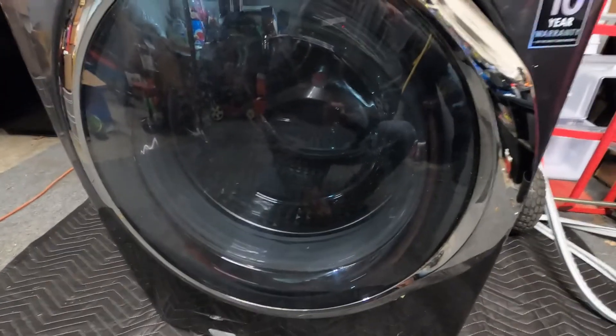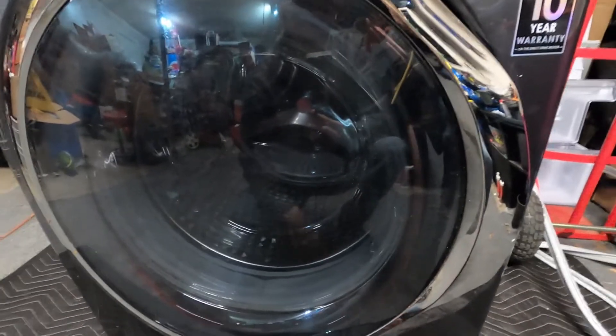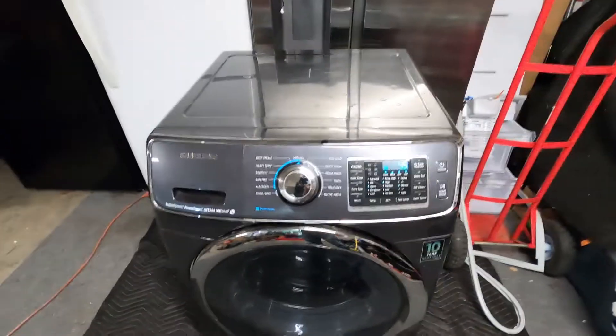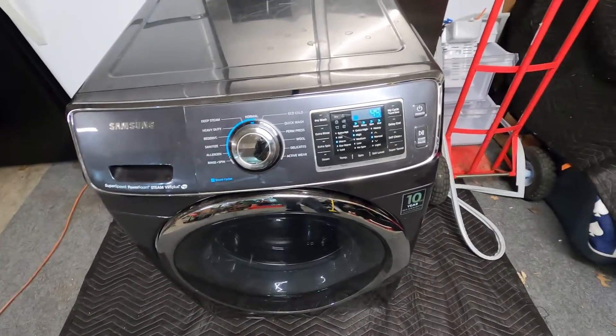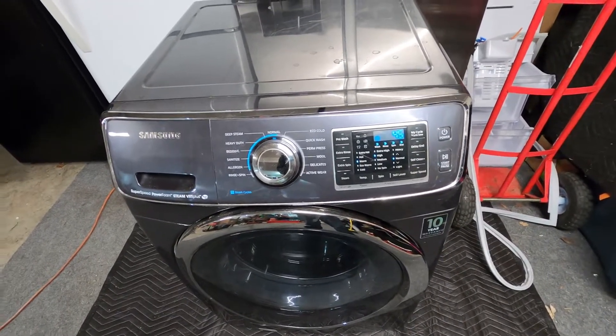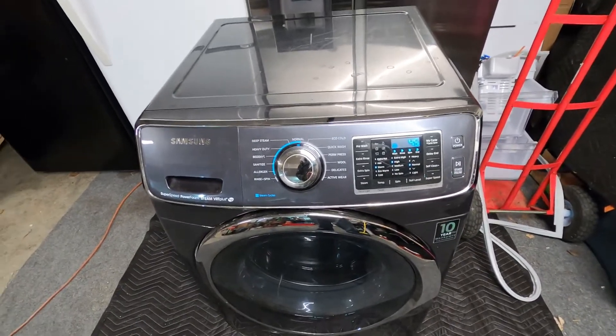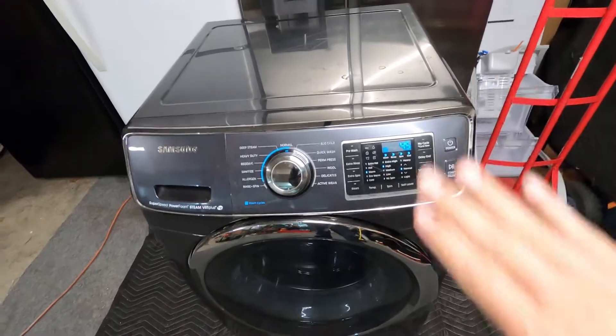On the back side of this washing machine you'll see this vent right here. This vent allows air to escape, because the machine has to be watertight. The way the machine picks that up is via the pressure sensor — all those millions of little bubbles that are popping, the pressure sensor is picking that up. There are no dedicated sensors that say you've got way too much soap; the only thing that can detect it is the pressure sensor.